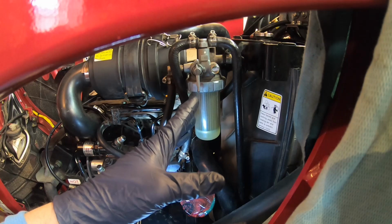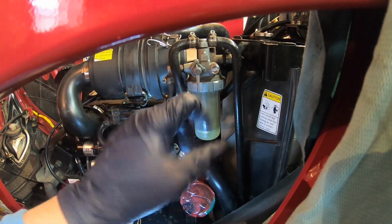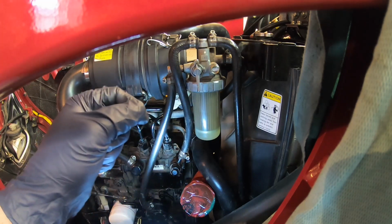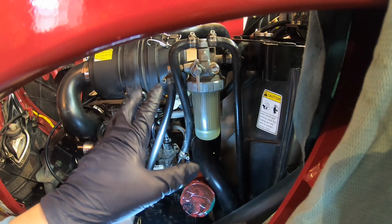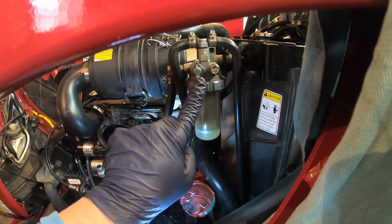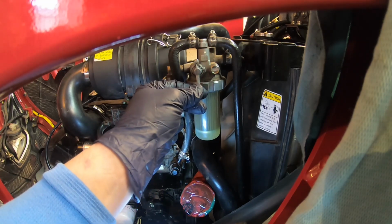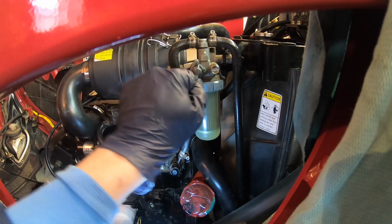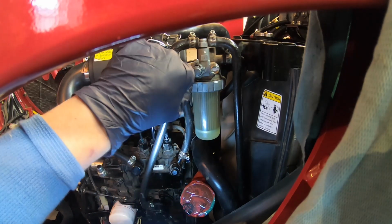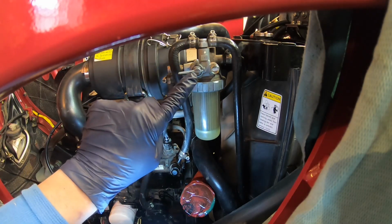All right, so the first thing you need to do before closing the valve here is make sure you remove the keys from your engine, so you don't start your engine inadvertently. All right, now the first thing you need here is to close the valve. If the valve is very tough to move for whatever reason, don't force it too much. Just work it back and forth and slowly go. So right now it is closed.